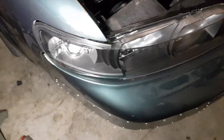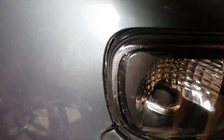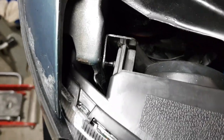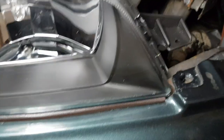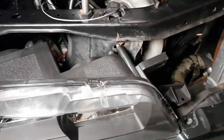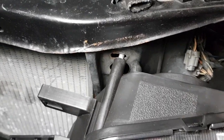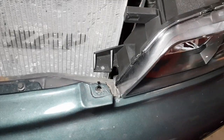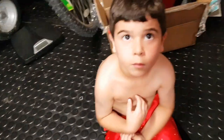I put this light on and there's a little gap on the side I don't like. I'm probably going to bend the bracket back a little more - that should help. It seals pretty good on the bottom. I'll have to put washers because the radiator support is pushed in from the crash. I put the other one on to test fit - same case, need washers there. Still have to cut this bracket, but other than that it looks pretty good.